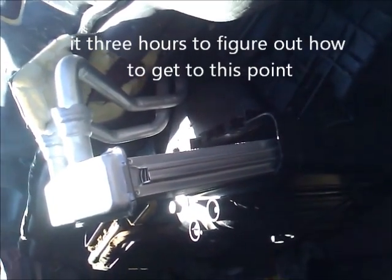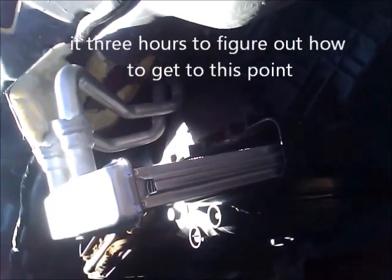That's what an hour looks like. I think I've got it started in there. I was able to cut this. I had to loosen all the bolts that hold this box to the back of the engine. I went on YouTube and the guy said to disconnect this computer, disconnect the bolts. There's 3, 4 of them under this side. And then there's a couple that he showed me that were up there, and one right there, and a ground screw. So there's a couple up underneath there.